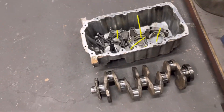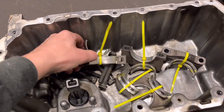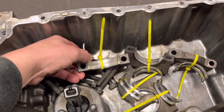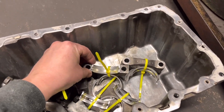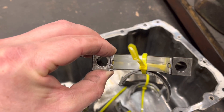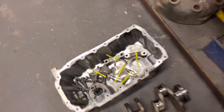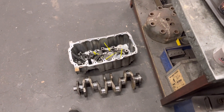So I'll just show you — we've got the main bearings here, which don't look too bad. But bear in mind, there's a very unusual sort of wear mark in there. We've measured that and it's perfect, so we're going to polish that and obviously fit a set of crank bearings.